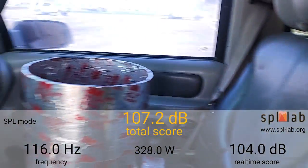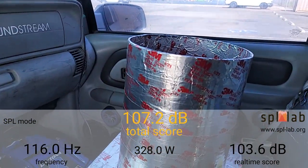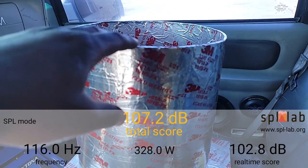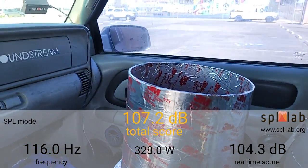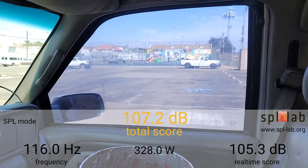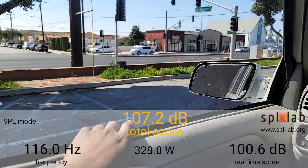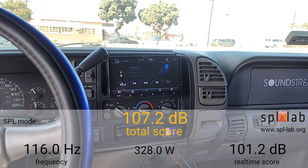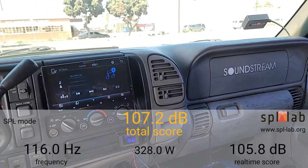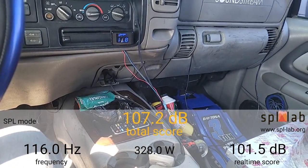I took it out today just to see — right now it has an 8-inch PVC pipe, kind of like big-ass ports inside the box. This box right here is below the window line. It's the two Soundstream X515 — the team Soundstream subs — their dual 1-ohm wired at 1 ohm on the Soundstream Triple X 15,000D. For testing purposes, I was able to get a 151dB as the highest no matter what application I use. 151dB was the highest I was able to do with the 10-inch port that I made. So I figured I'll check out the 8-inch port to see if there are any gains.